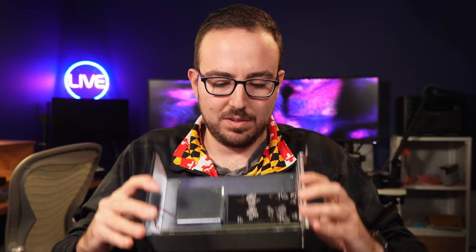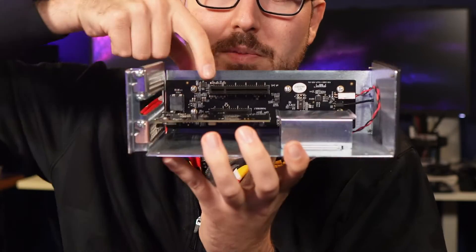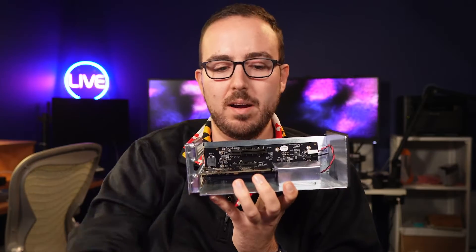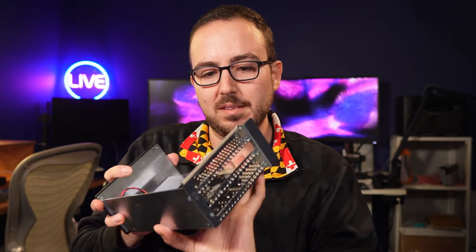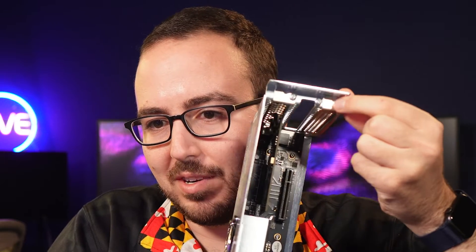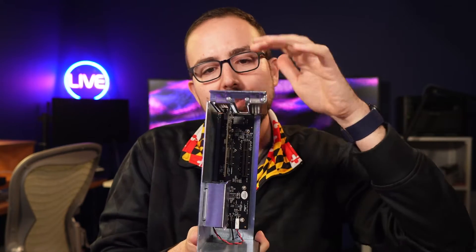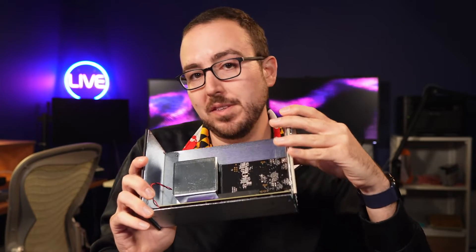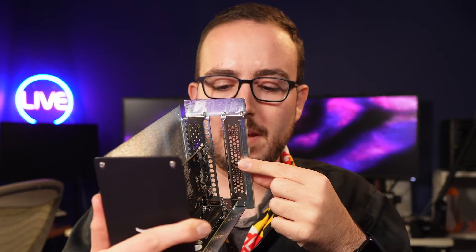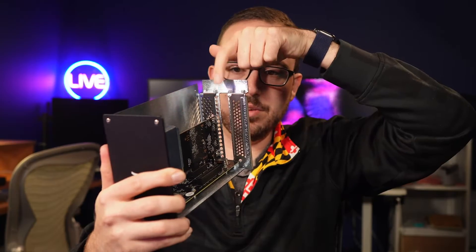Inside you will see that you've got a chip that's already connected in there — that's so that you can get power and Thunderbolt and all that figured out. You've got an open slot right across the top, and this is exactly where our Decklink Duo 2 is going to fit. There's one screw that's going to hold the Decklink locked in once we have it, so let me take that out. You'll notice there are probably three screws if you have the same enclosure — one holds a top vent piece on the back, one holds the bottom piece, and you want to make sure you take the middle one out because that's where your Decklink Duo 2 card is going to go.